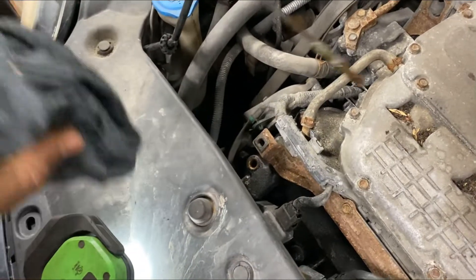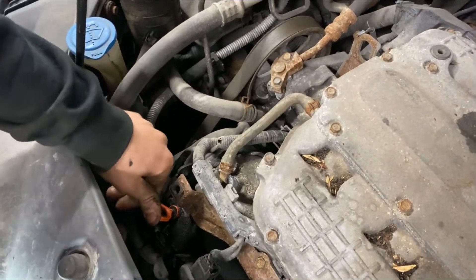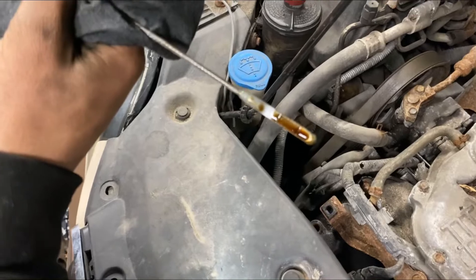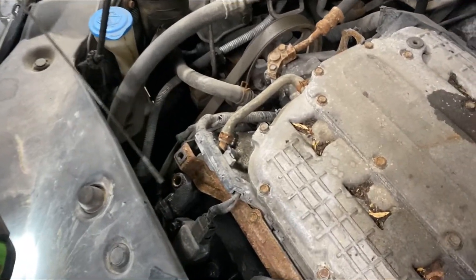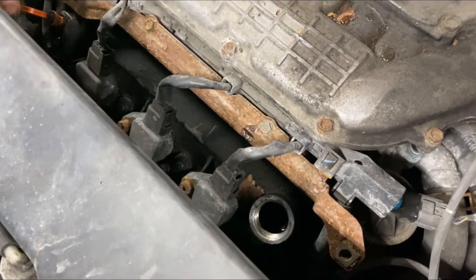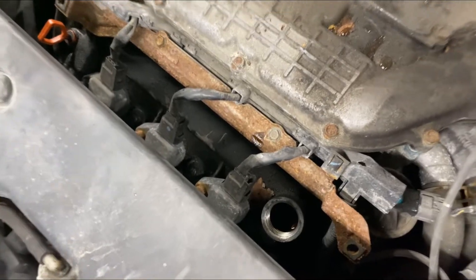We'll wipe it and double check as we did in the beginning. As you can see, the oil level did not change — it's still right where it was before — so it's quite possible that no damage has been done to the engine. However, like I mentioned earlier, I would recommend getting an oil change immediately and replacing the cap first and foremost. I hope you enjoyed the video — please like, share, and subscribe, and comment down below what other experiments you'd like to see.